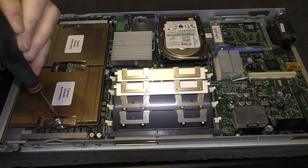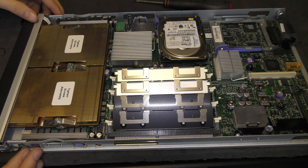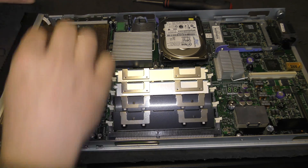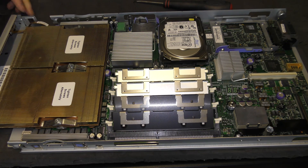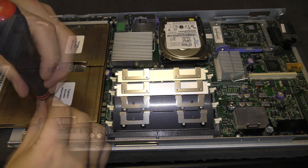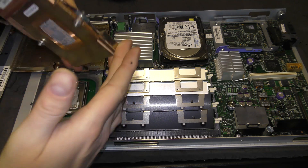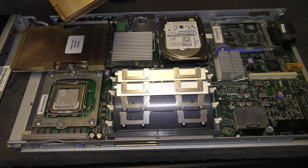To get this out right I need to take out the front — there's a little lever here that should enable me to remove the front of the server, just by a little bit, because the heatsink goes in under this piece of metal. This feels very loose now, and it comes right out. You can see the cooling compound that's been underneath.